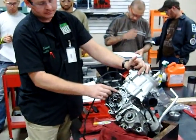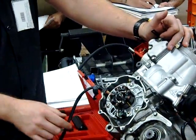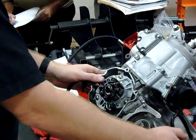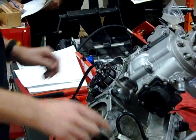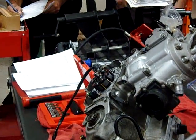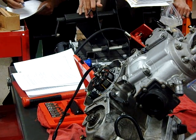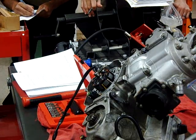Can you see the paint mark there? The one thing about this ignition on this Kawasaki is I can see all three bolts are slotted. What does that tell me when I have slotted bolts? It tells me that it's adjustable, which tells me that there's going to be a procedure for putting that back together.